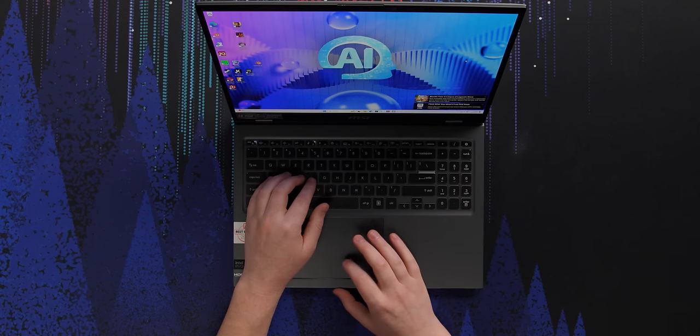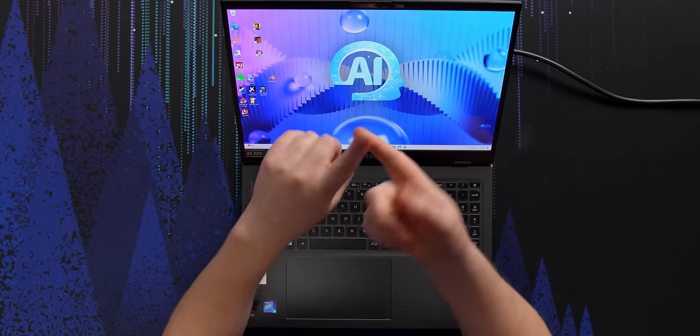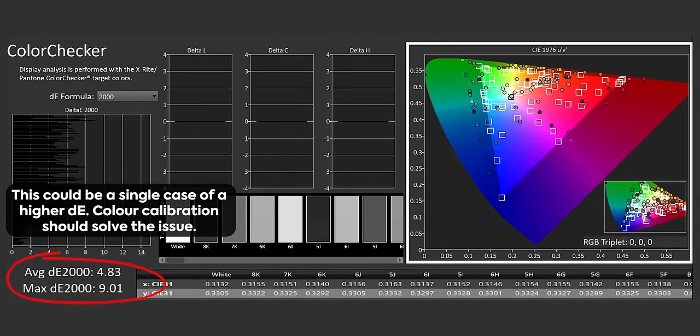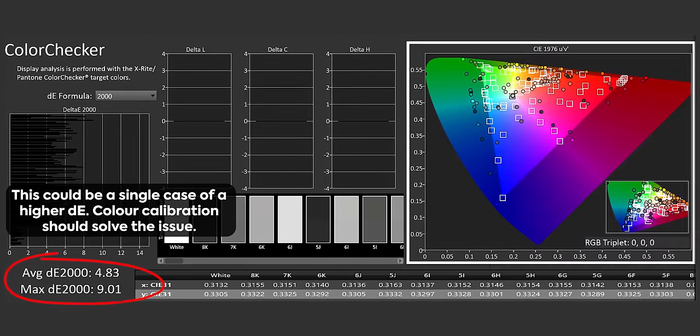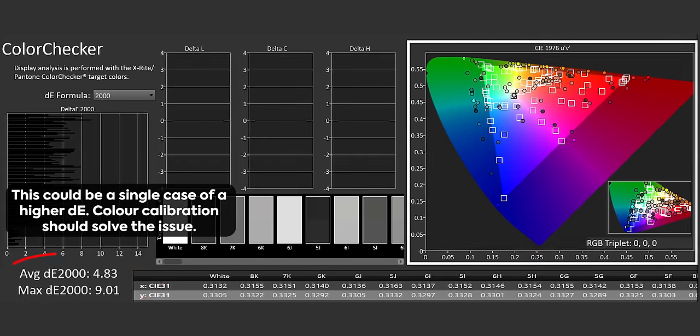This has an OLED panel. I don't even need to look at my notes to tell you that much. Just using my eyeballs, I can pretty easily tell you that this is a fantastic looking display, but our labs did have a sniff of it, and it's actually kind of interesting. It is quite good, but what's interesting is that in SDR, the accuracy of the panel is actually pretty bad with an average Delta E of 4.8, which is way higher than the two that we would expect for professional work, which is what this is aimed at. Everything's a lot more vibrant than it should be, and we weren't able to find any obvious ways to stop that.